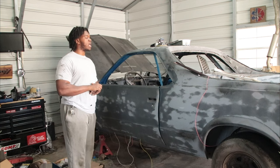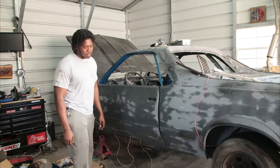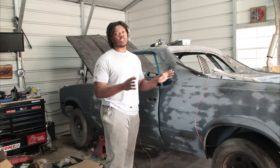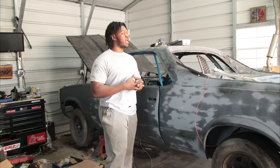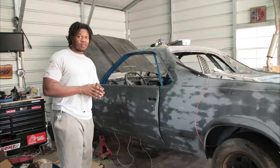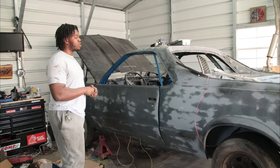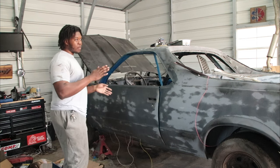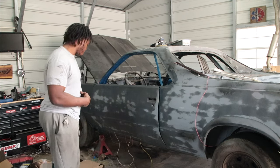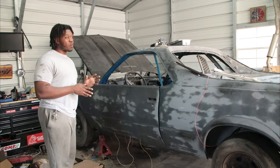Now that we covered all that, let's go over how I would have done this car — in the condition it was, the floor pans, the motor, transmission, etc. This is how I would have done it: I would have gotten this car, left the exterior alone. There was absolutely nothing wrong with the exterior other than it needed to be painted — it wasn't rusty, it was perfect. I would have got some rally wheels for this car, done the floor pans, checked over the brake lines and the brakes to make sure they were good. Then the next thing I would have done was put the motor and transmission in this car and drove it around — got this car mobile first, got it where it was moving and driving.